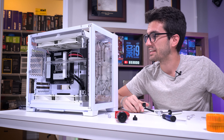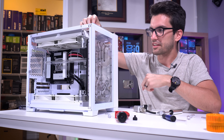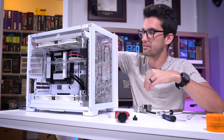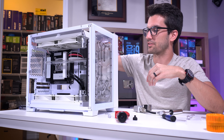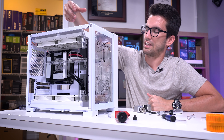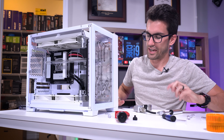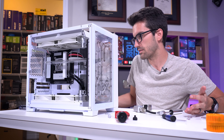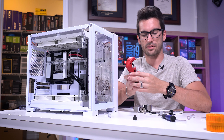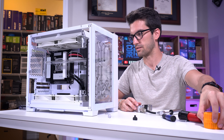It is getting late into the night. I removed the graphics card just to make things easier. It was actually quite difficult to get the really small tube links to connect between the radiators and the distro block up front. I had to slide the radiators back - thankfully the O11 Mini has plenty of sliding space for these 280s - which gave me enough room to insert the small tubes and then push the radiator back in. The CPU runs were super simple, just different lengths. Get yourself some pipe cutters and a deburring tool and you'll be good to go with PETG.